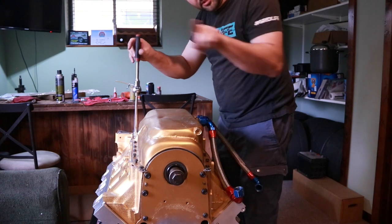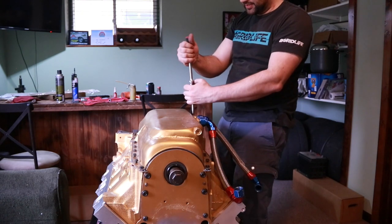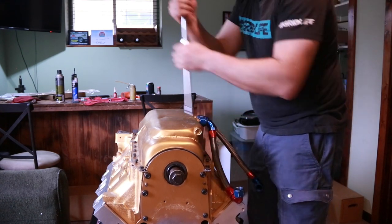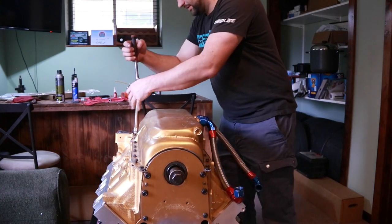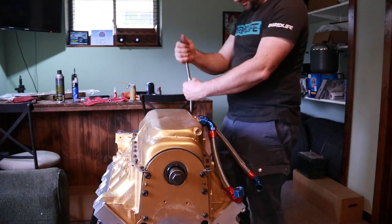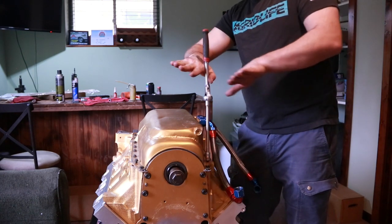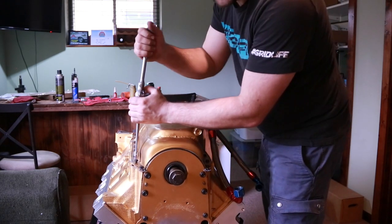And we're just going in a circular outboard spiral. That's usually how most bolt sequences work on just about anything, be it an oil pan, heads, intake manifold, and that's just to keep from torquing down the ends and then having a bow in the middle that you can't really squeeze out of it, versus if you go from the middle, you can kit that down and then any excess distance can push out as you continue to tighten, or at least I think that's the theory.